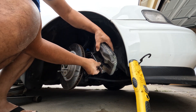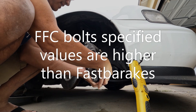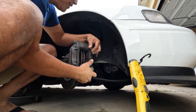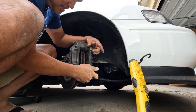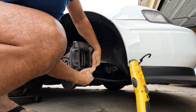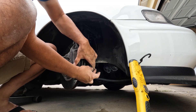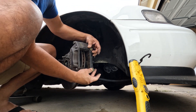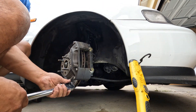Also about the torque — FFC gives you a much higher torque value than Fast Brakes. The FFC bracket I had, I ended up pulling the threads off because of too much on and off. I would recommend just using the Fast Brakes torque values, which is 40 foot-pounds — that's what I'm using. But it's your brakes, so it's all up to you.